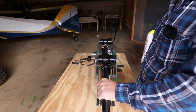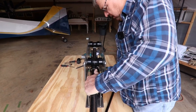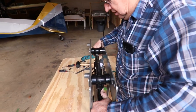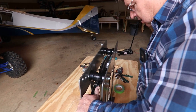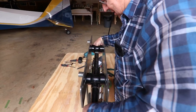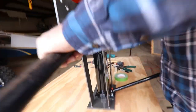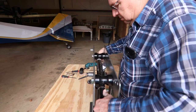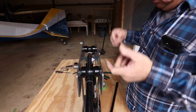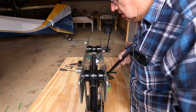This takes way longer than the JD Squared would. But to do this with the JD Squared would cost $650 just to get the bender and the die. We're just not spending that kind of money — if we're going to spend that, we'll just buy bumpers. You can actually feel the pump handle getting softer as it's actually bending. You can fix the shims to the rollers if you want, but I want them to be able to roll with the tubing. Some people weld them to it — I don't think that's a good idea. They're simply protecting the pipe from getting huge dimples in it.